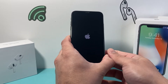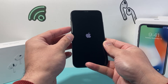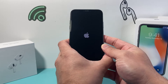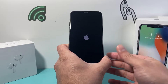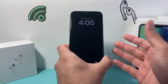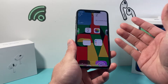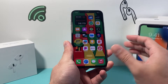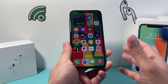The phone should be turning on normally. Again, make sure you press volume up and volume down one after another quickly before holding on to that side button, and you might need to do it a couple times before you get the hang of it. If you do it the first time and it's not working, just keep on trying it until you can get that Apple logo to appear, and once it appears, hopefully your phone turns on normally and you should be good to go. This method will not delete any of your personal data, so all of your photos, videos, and apps will still be on your phone.